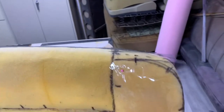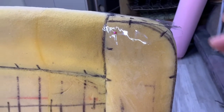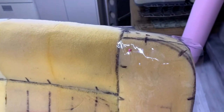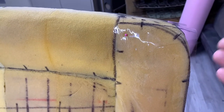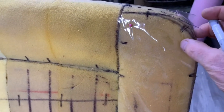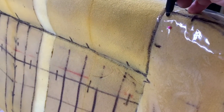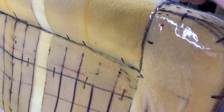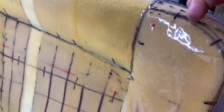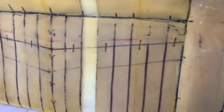When we cut that out, we'll add our sew allowance — in my case there's going to be a French seam, so I'll do a half-inch sew allowance, putting a dotted line all the way around. When I sew that together, I'll sew this line first, hooking the two pieces together. Then I'll fold out my sew allowance — half an inch on both pieces — and come back with a piece of vinyl the same material, lay it facing up on the back side. The half inch will be folded out on both sides with another piece of vinyl back there, making a really strong seam.